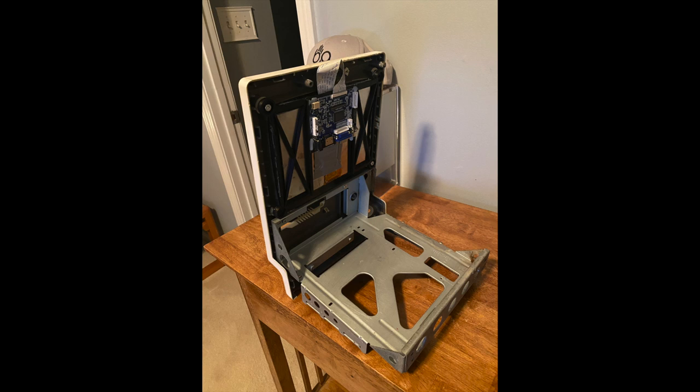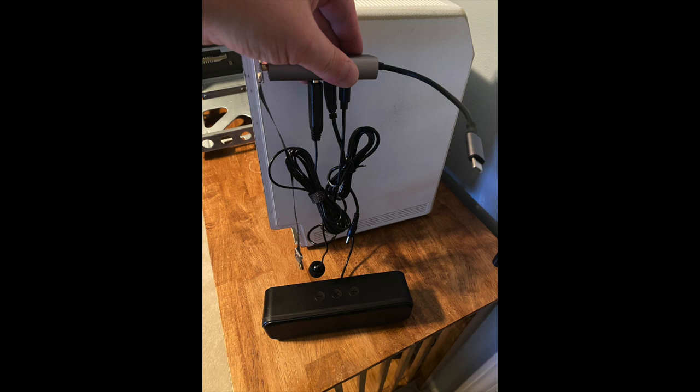Then after a little bit more time and ordering some products, got the USB-C hub put together. And on the left there is the ribbon, the HDMI ribbon cable, and you've got the microphone and then the custom power cord for the screen inside. And the screen, I guess, was originally intended to just be powered by a standard DC power brick, but they actually make USB to DC cables, so it could be powered by USB instead of a DC power plug like on the wall. So yeah, we got the hub together.